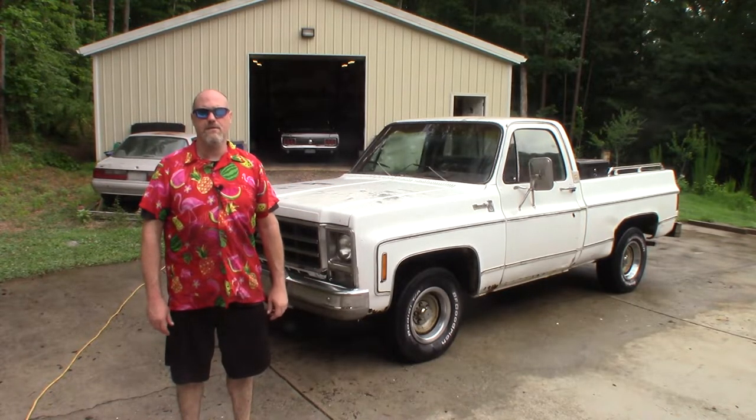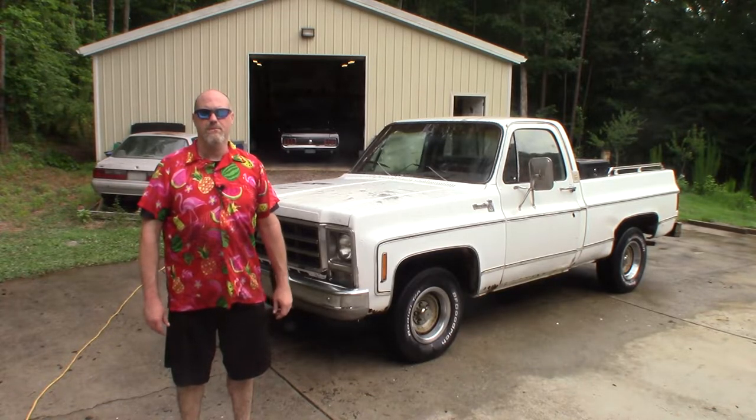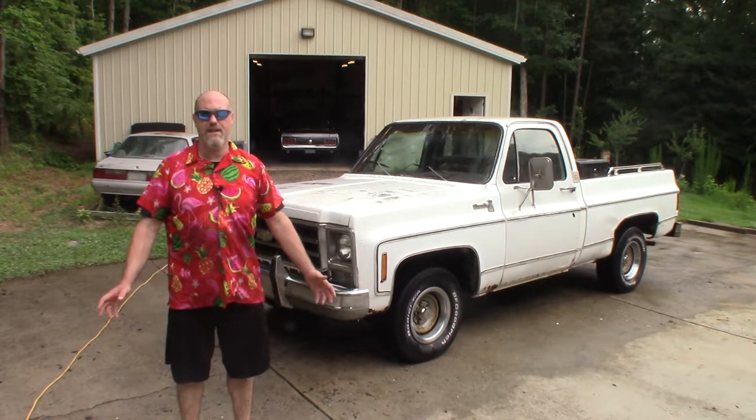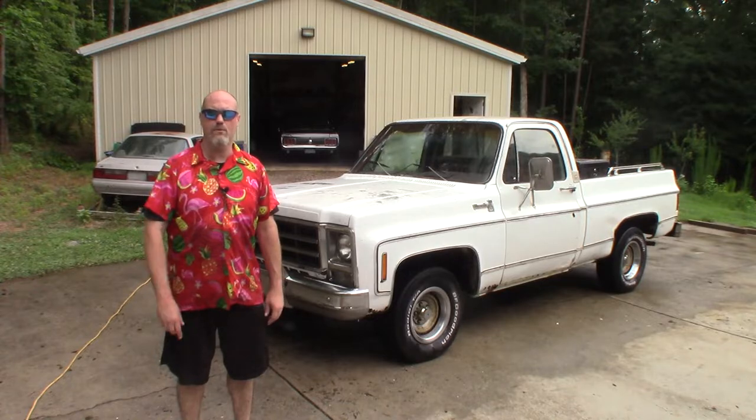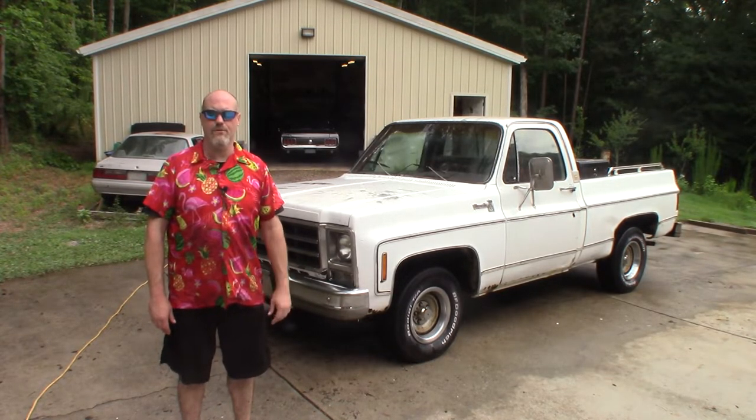Pressure washed up, she's all cleaned up. Found a little bit of rust spots that we're gonna have to fix, but she's cleaned up for now. Next video, not this video, we'll probably go ahead and change out the lock cylinders. Got some wiring issues. She only starts when she's in the run position. She just turns over and starts, so there's a wiring issue or ignition switch or something. And then the gauges don't work, so we're going to do some troubleshooting there.